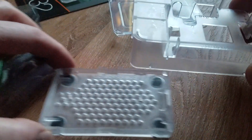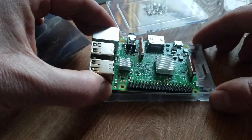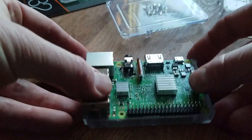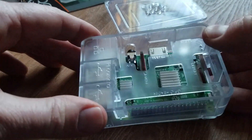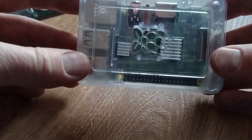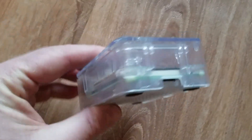To open the case, take off the top and set it to the side. Then come in with a couple of fingers and push the bottom out, and the middle section will come out too. We're going to align the Pi with the USB ports facing the correct direction and set it right in the bottom of the case — no need to screw it in, it fits nicely. Once it's snugly set in, place the middle layer of the case right on top, punch it down for a snug fit, then put the top back on. That's how you insert the Raspberry Pi Model B into the case.